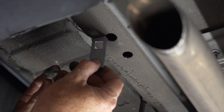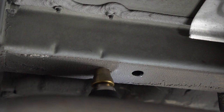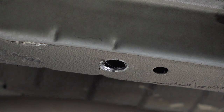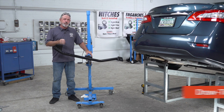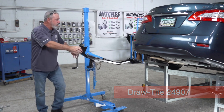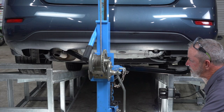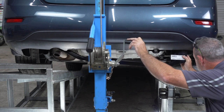This is the hardware that needs to go through the frame, and you can see that it just doesn't quite fit through that hole yet, so we're going to go ahead and take a step bit and widen that up. Now that we have the underbody prepped, we're going to put the hitch up. I'll be using a U-Haul exclusive hitch jack to do that. If you don't have one of these hitch jacks, I do recommend you get an extra set of hands. What I'm going to do is raise the hitch, angle it over the exhaust tailpipe, and then raise it up into position.